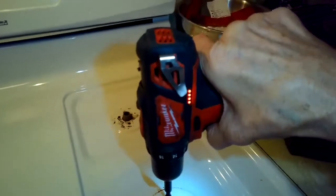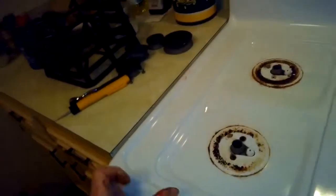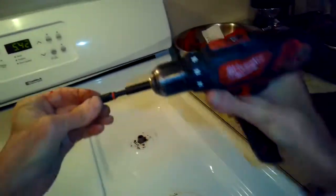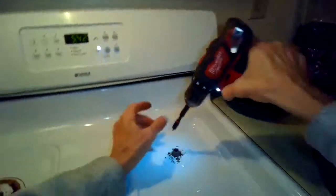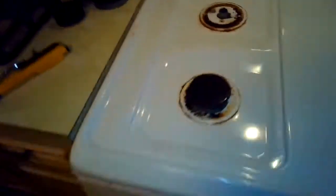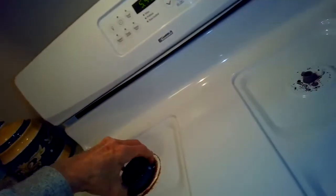It's usually the front burners that have trouble on this unit. The front left burner igniter switch, right behind the burner knob, just wore out because it gets used all the time — and it's pretty easy to replace. That one still doesn't have any effect, but when you turn on the burner to the right, all the igniters click. So I know the igniters and spark module are good — it's definitely the switch in this case.